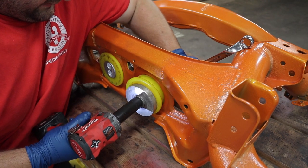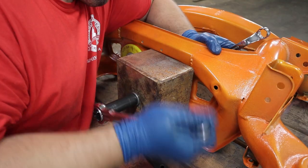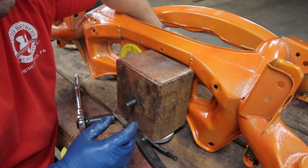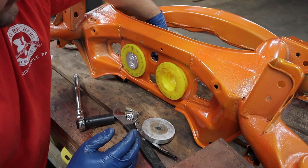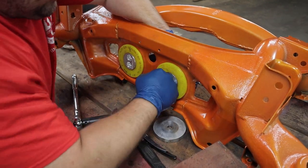Part of my trouble now is the big metal block I'm using is a little bit too big and won't seat flush on the subframe - not an ideal tool. But hopefully I can get it in just enough and then punch it in all the way. The diff bushings are done.